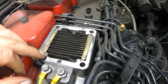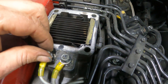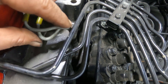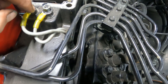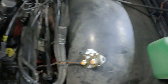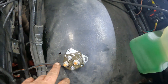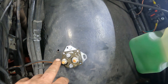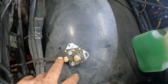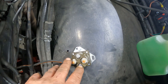In this one here they have two grids — you got one on the top right here and then there is another one underneath it, so that's why you got two posts. I'm gonna hook them both up. Like I said, the 7.3 wiring for the glow plugs — that wire comes automatically split off like that, so I figured that would be perfect. I've got the Ford 7.3 glow plug relay that I'm using for this. That way I basically just have to run one wire, because with the original Dodge setup you got two wires and two solenoids, and I didn't want to do all that — I just wanted to have one big solenoid and go that way.